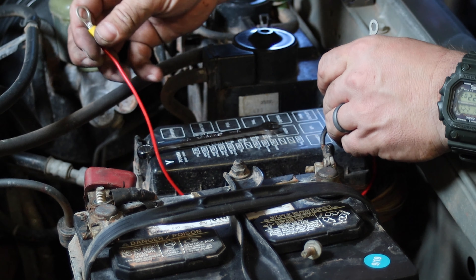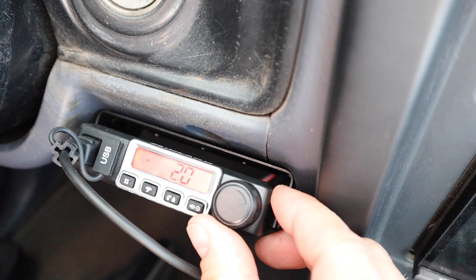There's a plug for the 12-volt socket, but you can also clip it out, attach some connectors, and either hardwire it to your battery or run it into one of your accessory plugs. We're going to hardwire to the battery today because this vehicle is limited on accessory plugs off the fuse box. For me it's just simpler to run it to the battery — bolt it down and know that whenever I want to turn the radio on I can just hit the button.